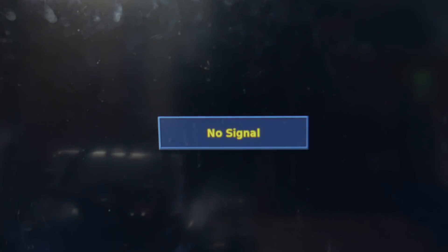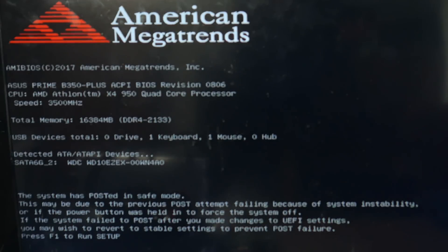Unfortunately, I couldn't post with memory clocked at 2400 unless I loosened the timings. Memory clocked at 2133 with tighter timings performed 2 to 3% better consistently, meaning that 2400 MHz was kind of pointless for me. This also means that memory timings could play a significant role with Athlon APUs and CPUs — something I will test in the coming weeks, so stay tuned. Because of instability and performance, I kept the memory clocked at 2133 with timings at 15-15-15-36.